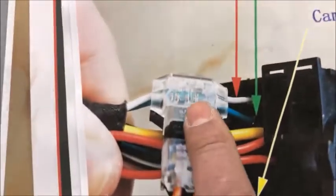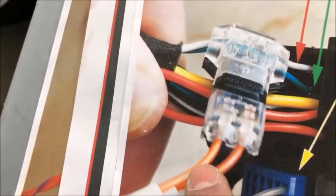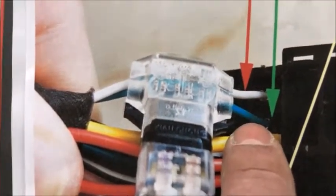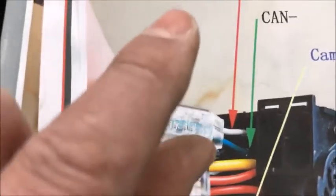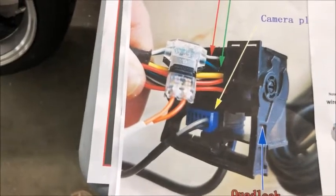Here is the little splicer that comes in the kit for the CAN bus connector. CAN+ is on top and CAN- is on the bottom — make sure the wires are in the correct order. The color of my wires in my connector are orange and lighter orange rather than white and blue, but they do go in this order — CAN+ and CAN-. You basically put it there, clamp it on, make sure the wires are in the right channels, and squeeze it together with pliers. These guys also have mute videos on YouTube showing how to do this.